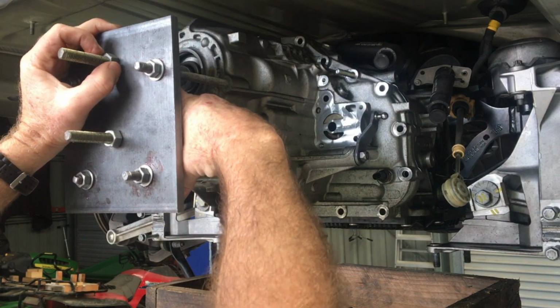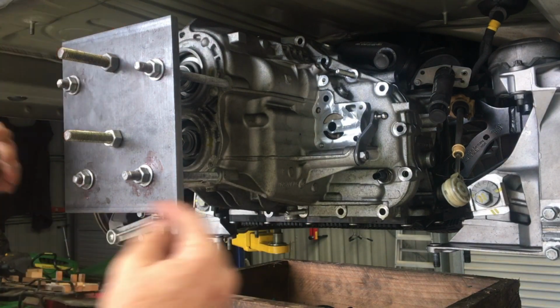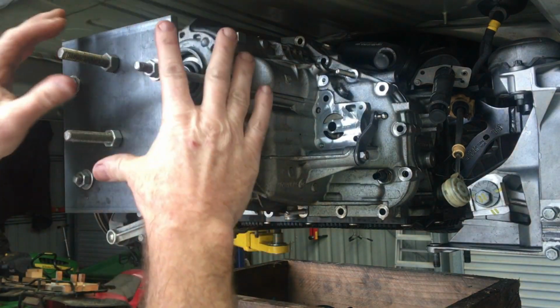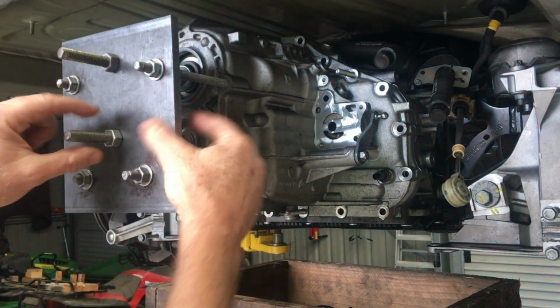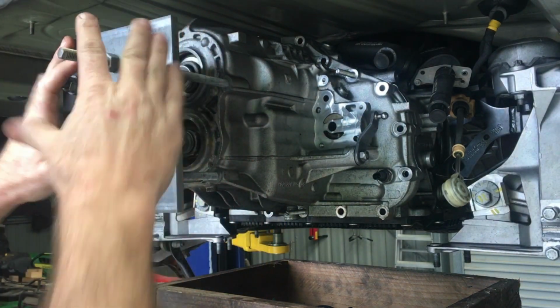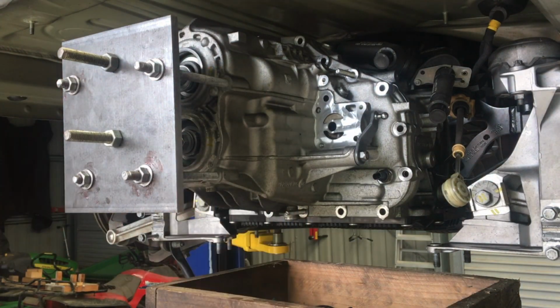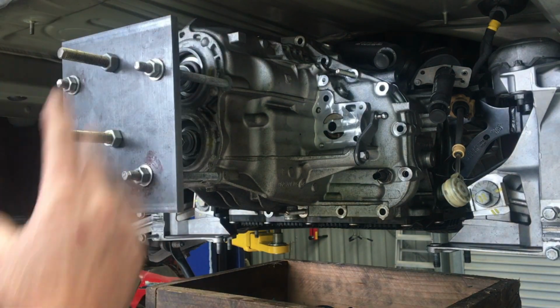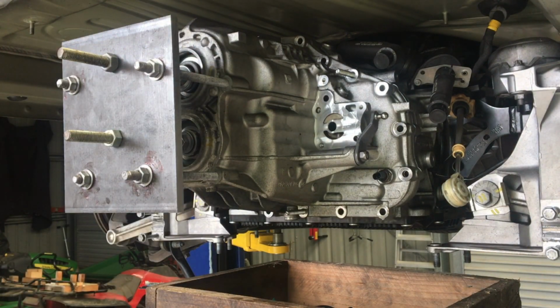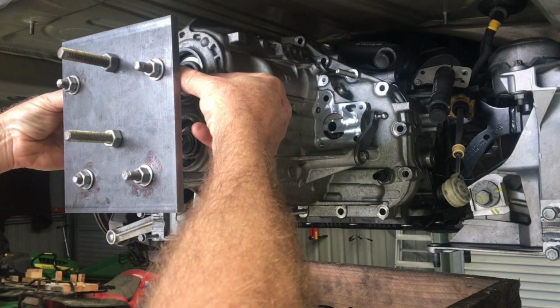The bars that are pushing on the shafts, you can adjust the nuts on the end here so everything's at exactly the right distance, and then I'm going to tighten down the nuts on either side here so everything's nice and secure, and make sure everything is perfectly square. If you wanted to, you could measure the distances in here to make sure they're all even, to check that everything's nice and square.